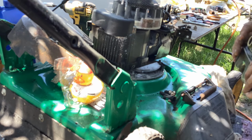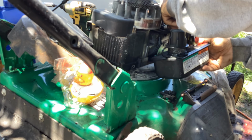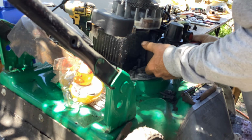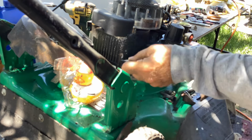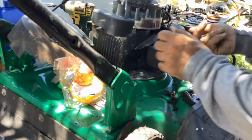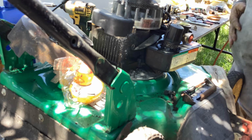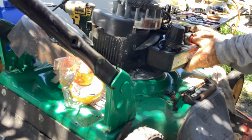Okay, my O-ring and keeper are in place. Put my linkage, breather tube elbow. Okay, get that started. Here's my piece of sheet metal spacer. Get that lined up. 13 millimeter, just hand start it. And the 10 for the tank, get that started.